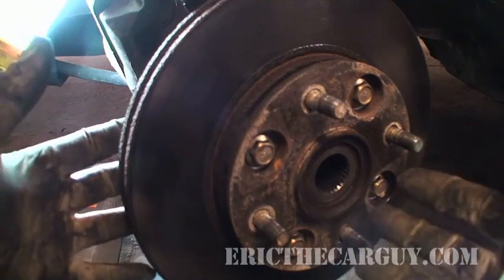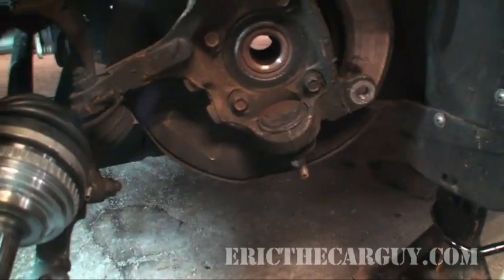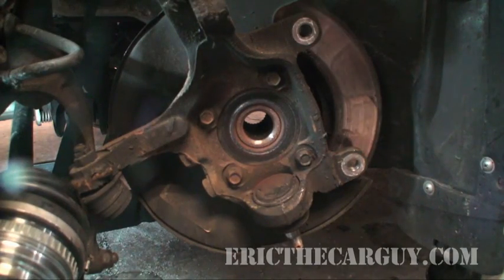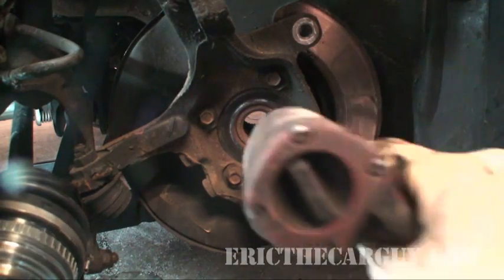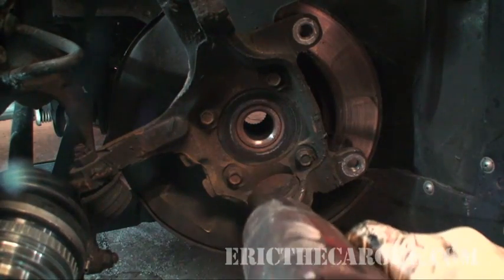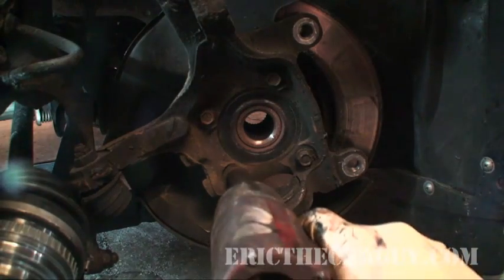Yes, it does save you some time, but the fact that you break this bearing open means there's a chance for failure of the bearing, so you'll be back here doing this again anyway. Yes, what I'm showing you is more effort than that — however, it's better. Why is it better? Because you're doing it the right way. You need to remove the bearing assembly from the knuckle. If you don't do that, you run the risk of killing the bearing, which means you'll be doing your work twice.